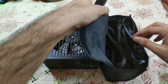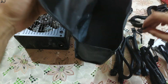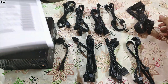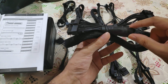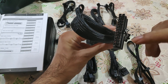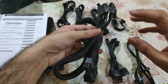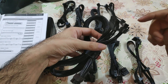So let's just open this bag and take out all the cables. I will refer to the manual to identify them. The first one is the 12V ATX cable — 24-pin (20 plus 4). Here it is. This is the 24-pin motherboard cable and you can see the capacitors are built into the cable itself. The cable quality is very good. This is the 24-pin plug — it is keyed so it will go in one direction only. On the other side there is an 18-pin plug and a 10-pin plug. Type 4 is mentioned on these cables — you must use Type 4 cables with this power supply.